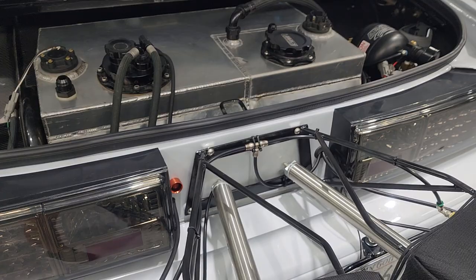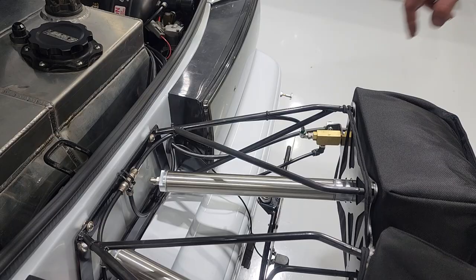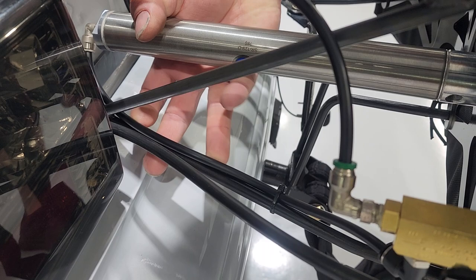Back to the CO2 plumbing - the CO2 coming back here is at 200 psi. It comes up to a T-fitting and goes to each one of these air valves. You've got an inlet to the air valve and then an outlet from there to the back of the cylinder. White Safety told me they needed 200 psi on the cylinders - instead of the 100 psi we were previously feeding it.